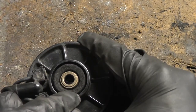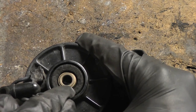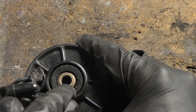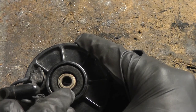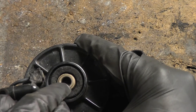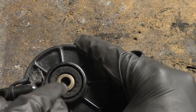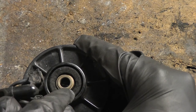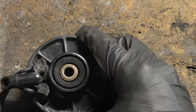The wick sits around the bushing, and the bushing isn't solid metal — if you look at it, you'd see it has very fine pores in it. What happens is the oil leaves the wick, goes through the pores of the bushing, and creates a thin film between the bushing and the motor shaft. As the motor shaft spins, that's what prevents it from wearing down the bushing. But when that lubricant is gone, you just have metal on metal. The motor shaft is harder than the bushing — the bushing material is much softer — so it wears away at the bushing, the bushing becomes egg-shaped, and the motor fails.